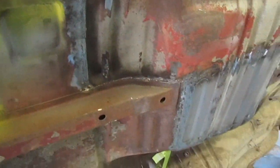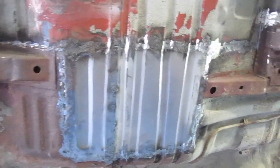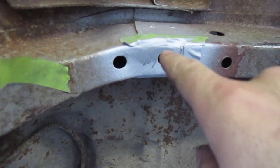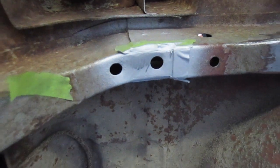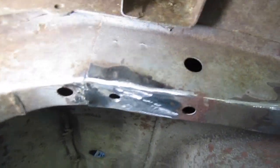I got a little progress done on the chassis here — got this ground up and cleaned up. There was a little crack in the floor I welded up, ground it, and the floor panel is all nice and cleaned up. The welds in here are ground down. Right where the frame rails overlap there was a rust spot in the center of this hole — I drilled it out and I'm going to drill another hole so water can drain out and not sit in there. Then I'll weld a plate back over top and drill that plate out too. And there is the frame rail repaired.